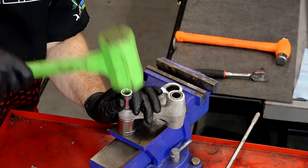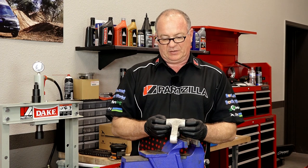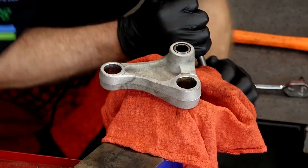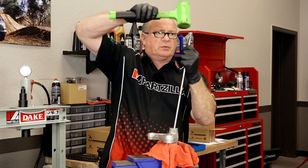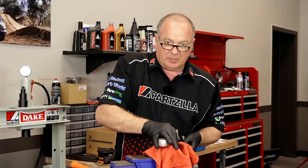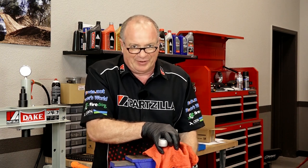Alright guys, that worked pretty well — knocked out the larger of the two. There's a smaller one here I'm going to do the same technique with, but then I have these two that I have to deal with differently. We're going to use a steel rod to see if we can punch them out that way. That actually came out a little bit easier than I thought, but I'd be a tough sell that that would work on the swing arm. If somebody out there tries it and is successful, leave me a comment below because I want to hear about it.